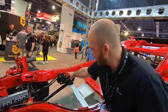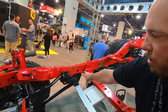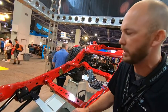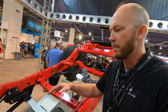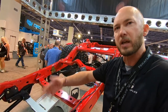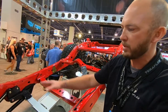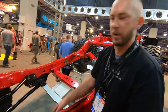Over on the other side, you can see the big black bracket. We've cut the factory brackets off, and that is our long arm kit. The arms over there are going to be a lot longer. Long arms are really good to smooth out the ride quality and give you a little better articulation off-road. When you get to too big of a lift kit, those control arms get really steep an angle, the front axle won't move up and down as fluidly, and it makes the ride rougher on-road and off-road. So depending on the lift height, the long arm or the short arm is going to be the better upgrade option.